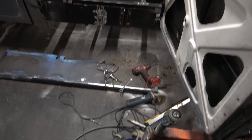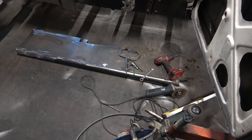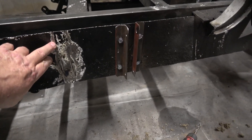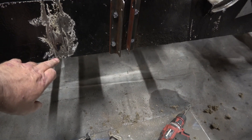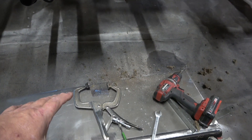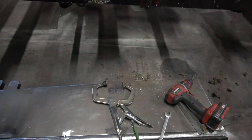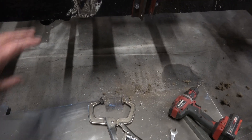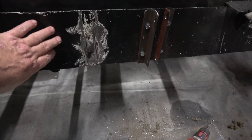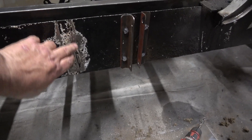So the next thing I want to get on with is putting this step side on. The way I did it originally was we welded basically an L-shape box section and then it went underneath the running board. The unfortunate thing was, even though it's made of 3mm steel, the outside of it now it's been sandblasted is quite thin here, so I actually need to weld this back up.